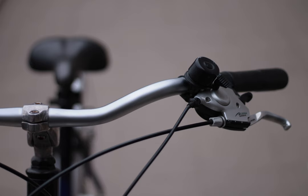Shimano 5800 11-speed cassette. I have an 5800 set on my bike. However, I changed the rear wheel, which comes with a Shimano FHM 756AL hub, which does not support the 11-speed cassette.